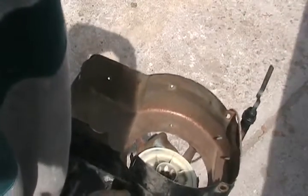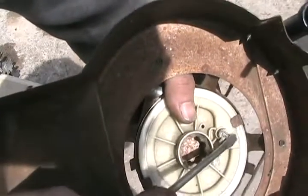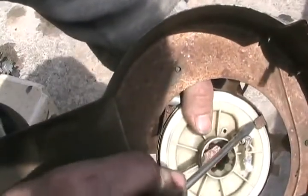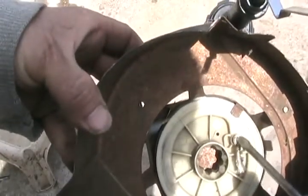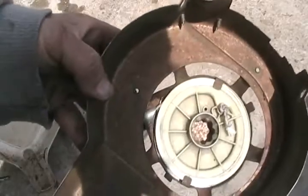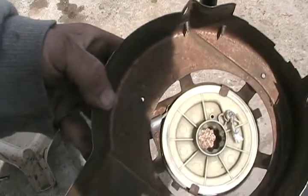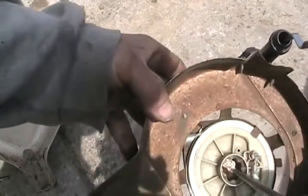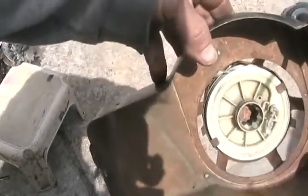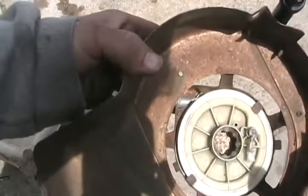Don't put the knob on yet because you don't know how long to make it yet. Now bend the tabs down, but leave a little slack — you don't want them pressing against here. They've got to have about a millimeter of space each. The knot here is just a double knot, an ordinary double knot. If you tie a single knot, there's a strong possibility it could eventually get yanked right through. Now if you have a sticky pull start that doesn't retract quickly, it's either seized on the ratchet — so take it off and oil the shaft — or just take off the pull cover and dribble oil down the center hole while holding it upside down on an angle. With maybe 10 to 20 drops in there, pull the handle back and forth to work oil into the spring, then reinstall it.